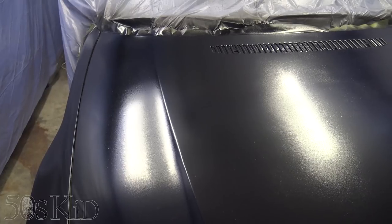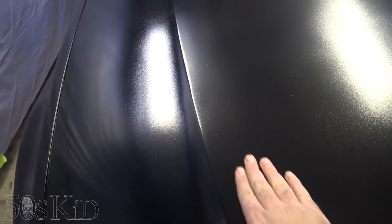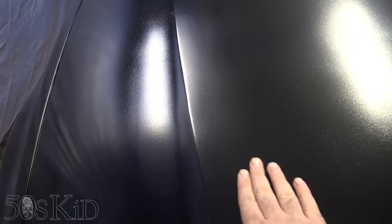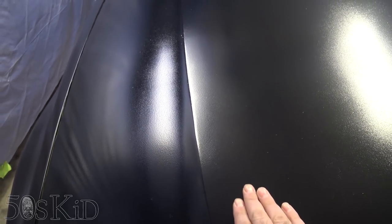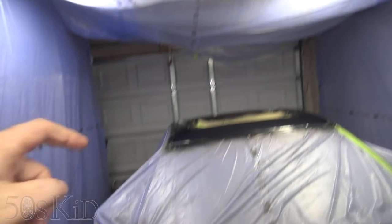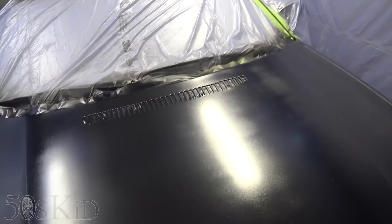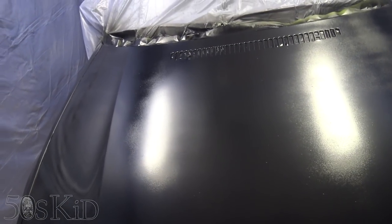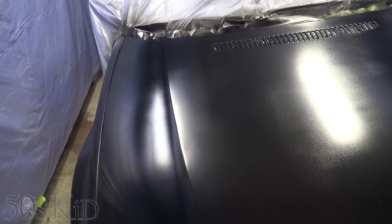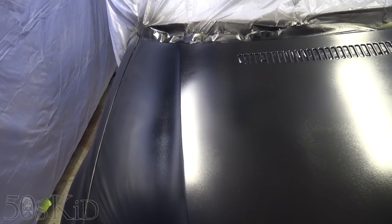However, the one thing that I didn't know about and didn't quite realize is that in some of the areas, like in front of the patch where I was sanding the edges smooth, I kind of rubbed through the clear coat down to the base coat in some areas. I got some bleed through with the base coat, which you can't see now that I've put the clear coat on, interestingly enough, but when I had just the base coat, I could see it was already bleeding through, and it happened up there, and it happened on the side as well. That was really interesting, and I didn't realize that. That one I didn't know. I just don't recall realizing that that was going to happen. So that one again is my bad. I should have known, but I didn't know. So now I do know. Now I have learned the hard way.